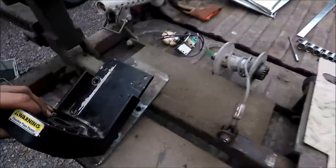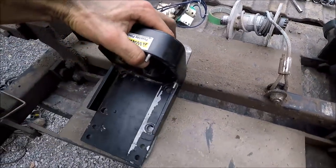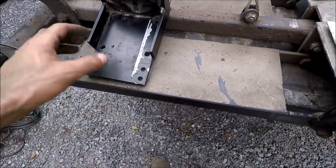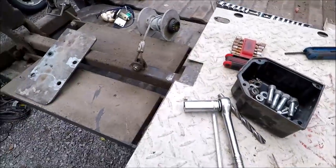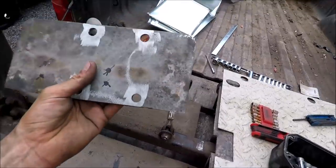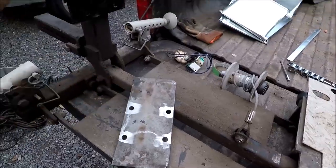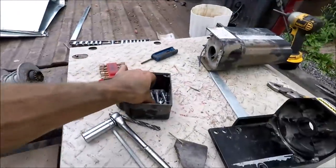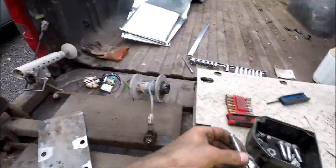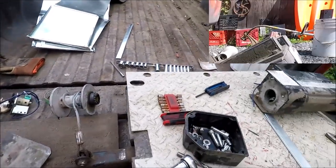That's going to go on like that — this part will have a nice steel plate on the back. Because this thing has been bent, it's weaker now, so this will give it a little more strength so it won't bend that way again. At least that's the theory. I'm going to use the same hardware — it does have enough thread on the other side to reuse it. I'm going to put it all back together — wish me luck.